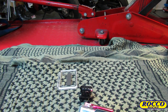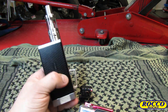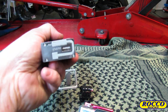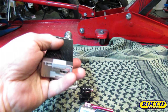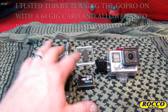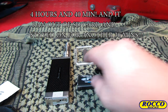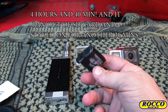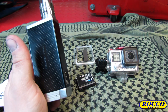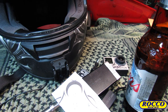The name of the game is milliamps. What I have here is an MVP 3.0 vaporizer — one of my old ones I don't use anymore — but it has an external USB port rated at 3800 milliamps. Do the math: 3800 milliamps versus 1100 milliamps is a little over three batteries. With a 64-gig card and one standard battery you get about an hour and a half to an hour fifty, so that's theoretically close to four and a half hours — enough to fill a 64-gig card at 1080p, 60 frames per second. Problem solved.